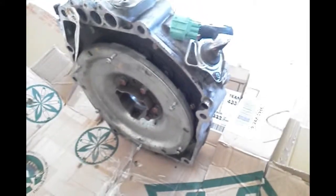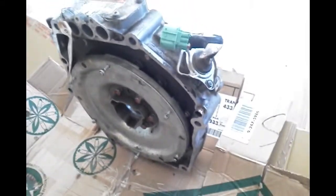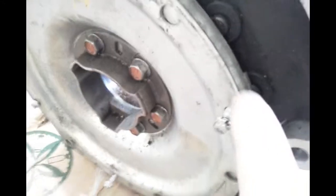Here is the 2000 Honda Insight — this one is actually from a 2006, but it's the same Gen 1 10 kilowatt IMA electric motor. You can see the three position or commutation sensors and the little plate on the flywheel that gives it orientation for the electric motor, on the side that goes to the transmission.